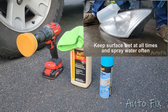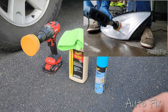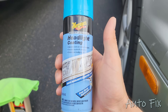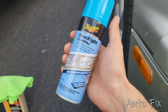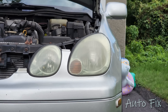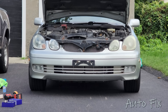I do have a video on how to properly buff and polish headlights to restore them. For a quick restoration like this, you can easily bring it back to life with a buffing pad on a drill. If you need to really sand it down, start with 1,000 grit wet sandpaper and work up to about 3,000 or 4,000 grit. Give it a quick buff and then protect them — when it looks hazy like this, it means the UV protective coating has been lost. Look at the difference in potential light output: I can't even see the reflector on the driver's side, but I can see every line and curve of the reflector on the buffed passenger's side. Huge difference.